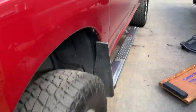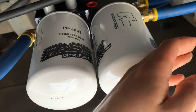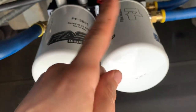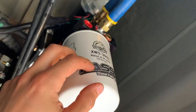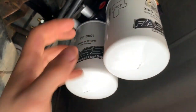We just got this thing wrapped up. I didn't get video of priming the filters because it was kind of a messy job, as you can see. What you want to do is keep the filter closest to the suction tight, and the one farthest from the suction — facing the front of the truck — unscrew that one just a little bit so air can push out through there. Once a little bit of fuel starts to come out, tighten it real quick. It's tricky on these Cummins trucks because unlike a Duramax trigger wire where key-off means pump-off, the Cummins has to run a priming cycle, so even if you shut the key off it's going to keep running a bit. Nice to have two people for this or it gets messy. Cycle the key on and off — it might take four or five times to get fuel through — and make sure you're priming it before you try and start the truck.